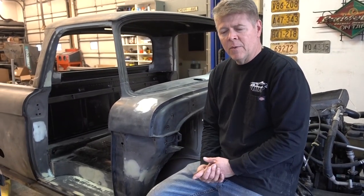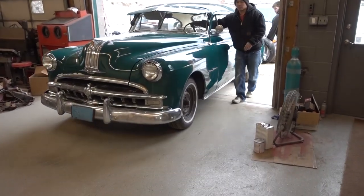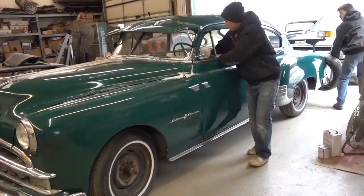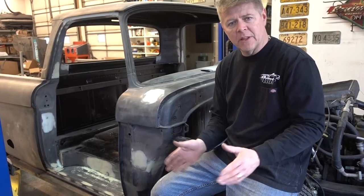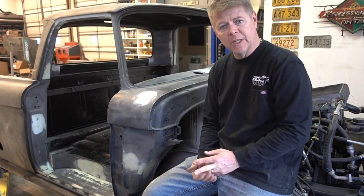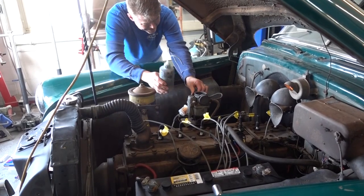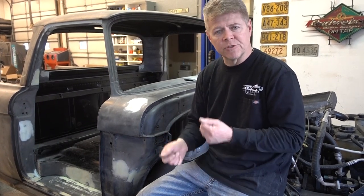What we've had going on this week at Legendary Customs: we had a 1949 Pontiac come in. You're going to see much more of that in the future, but we had to get the brakes in — the brakes had nothing there. We put in cylinders all the way around, new brake line, and I rebuilt the master cylinder, so now the brakes work perfect. It had zero spark; we finally got it to have spark. We found out that two cylinders have zero compression — two valves are sticking open, which would cause that. We'll dig into that again next week.